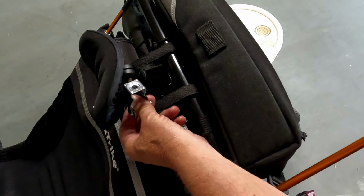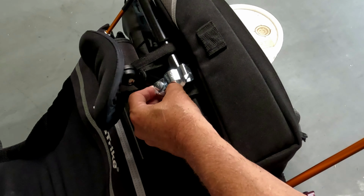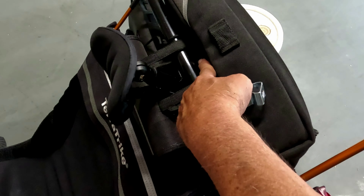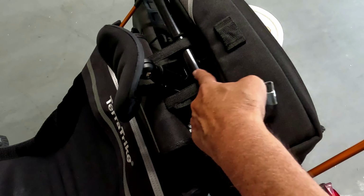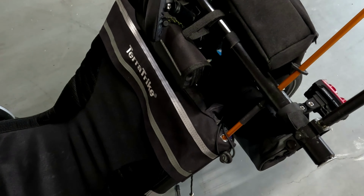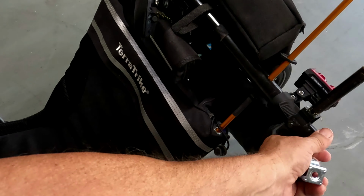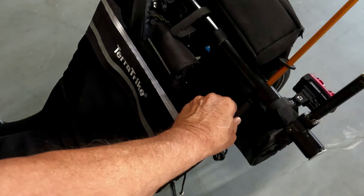And it's mounted like this and tightened down, and I drilled a hole through it up through the top and bolted it down right here with a nut and bolt, and that's what holds it to the trike steady. And that's why I needed to have this heat shrink over here so it wouldn't tilt either side, because it's pivoting off this point. So now it's not going nowhere. This is all on here.